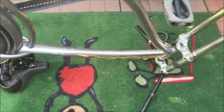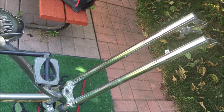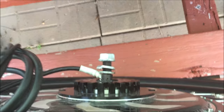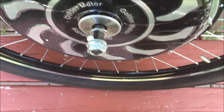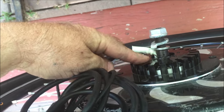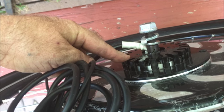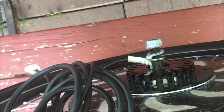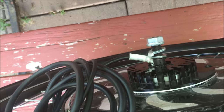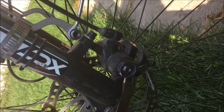I've got the bike upside down on a piece of carpet — no need to scratch things up. A lot of people ask: which way do I put the wheel in the bike? The freewheel always goes on the opposite side of the cable, because that's where the disc brake mounts. For all our motors except the 902, the cable comes out the opposite side from where the chain is, to accommodate the disc brake.